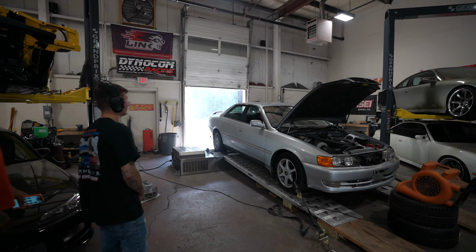Yo, it sounds nuts. Alright, so our wastegate is 12 psi. As you guys could probably hear, the runtime was a little short. I'm gonna change that to make it a little bit longer. I didn't really know what to expect. Wow. Barking. I wasn't kidding, it's loud. It sounds like a VQ, pierces your ear. So far, what's nice is I don't see boost creep, which is usually our biggest enemy here. Step one, good.